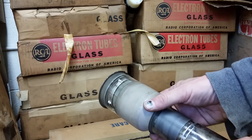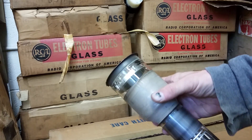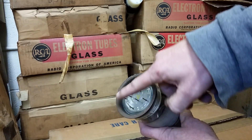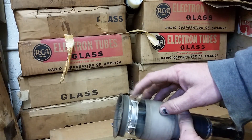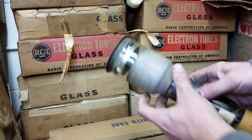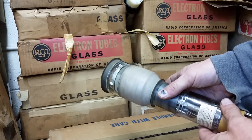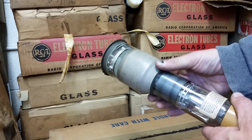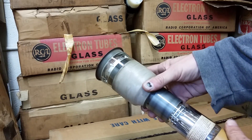You basically store your bits, or blobs, in between the wires of that mesh. On the surface here — on the face — we have a bunch of electrodes for reading out the data, because these basically attach to the other side of that assembly, to a metal plate. Now, apparently these things could store, theoretically, about 16 kilobits. In practice, that wasn't really the case — you'd get some splatter, and you couldn't get the full 16 kilobits. But you could do pretty well — maybe 4K or 8K, I don't know.